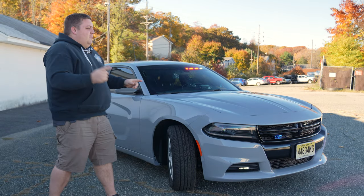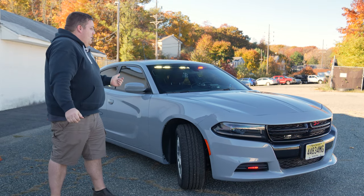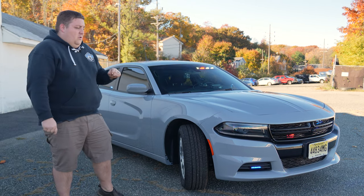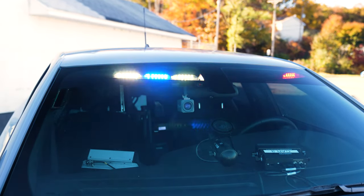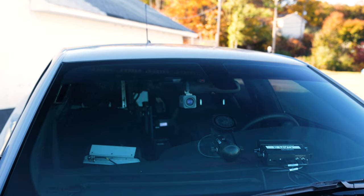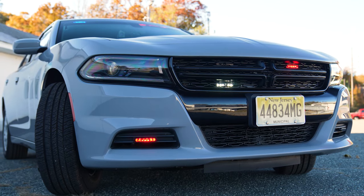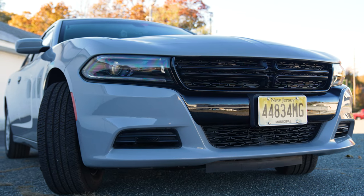We're taking a look at our drive response mode, all done through the Blueprint control system and the link module, which gives you the ability to automatically change the pattern and set functions such as the light patterns and park kill through the OBD2 reader — not requiring any splicing of the vehicle, maintaining your warranty. You can see we've added white flashing all over the vehicle, including our DRL flashing through the Blueprint control system. This is all set for the tri-colors with the white in it, and then throw it back in park and it shuts back into the park slow mode.